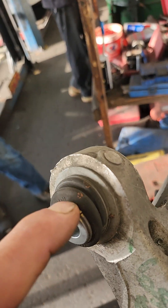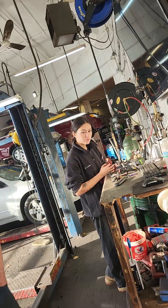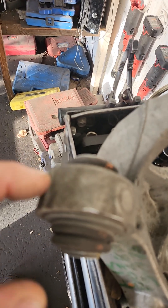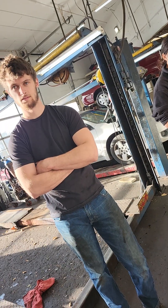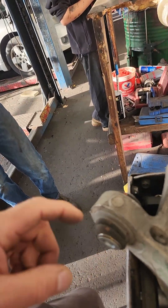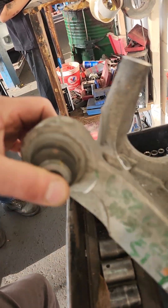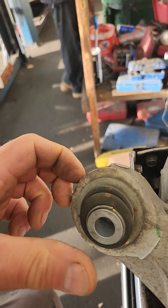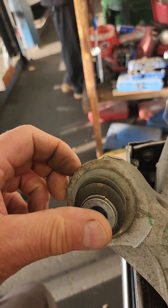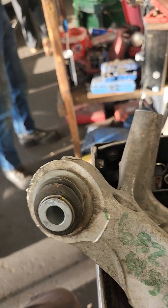What's bad about this is when these steel parts start knocking together, it emits such a horrible sound. My simple fix would be to drill a hole through this and add a zerk fitting — just to see if I could drill through the materials. It's aluminum, you could probably drill through, but this spherical heim joint down here is so hard. This piece doesn't move freely, so as the suspension is trying to move in all directions, it's emitting a horrible clunking sound traveling through the suspension.